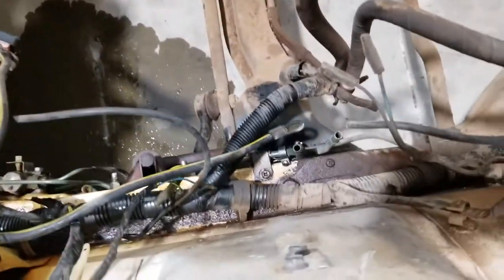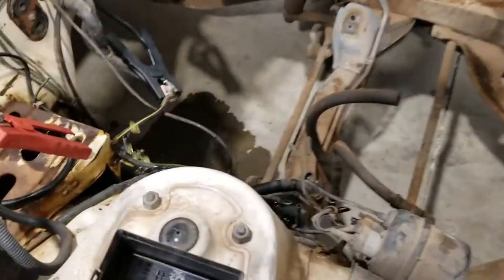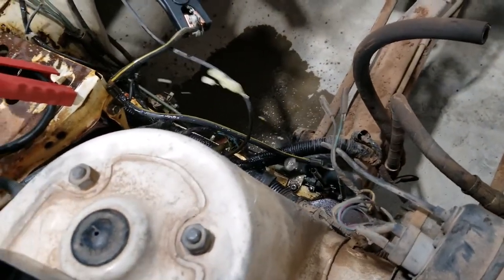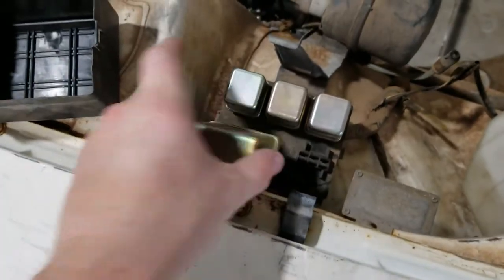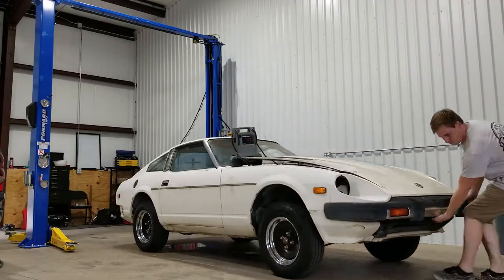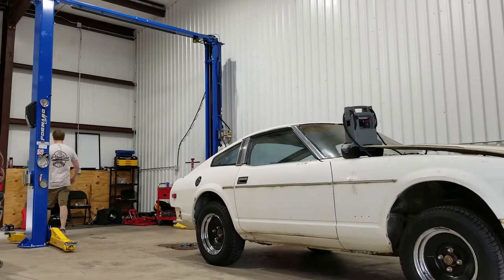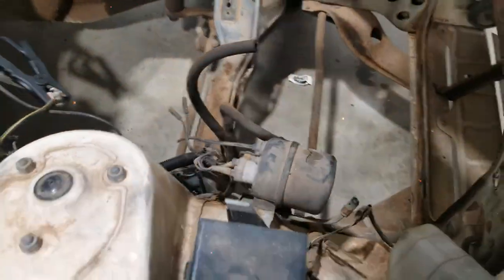That's gasoline. So I obviously removed the fuel line going to the engine. So I plugged up the jump box just to see what worked on the car, and I forgot to pull the fuel relay. So we're gonna do that right now. Ew. Oh, it's bad. It's really bad. Oh, and it was this one. This is the fuel pump relay. It was right here. I had four chances and it was the last one. So more fuel, lovely. Spewing everywhere, that's great. The fuel geyser.